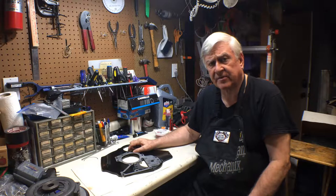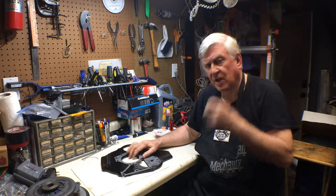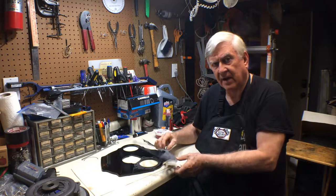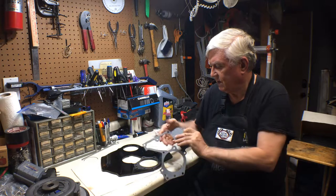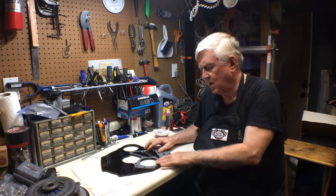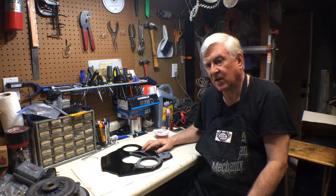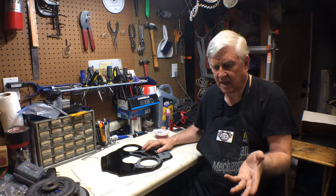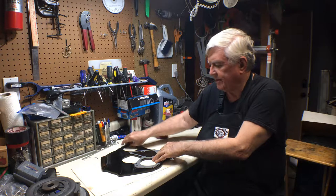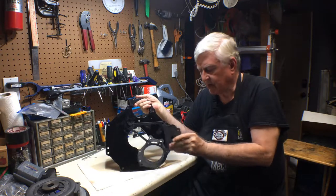Okay, a couple extra tips about painting. If you haven't done that before, go slow, use a little bit at a time. You'll get less runs that way. Try to cover everything. If you have to break it up into separate sessions, that's okay too. I use a disposable brush, so I try to have enough time that I can go completely through with one brush, then I toss it, don't have to clean it. That's my strategy.